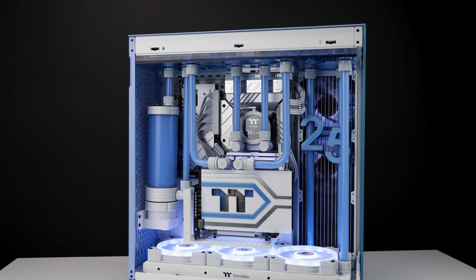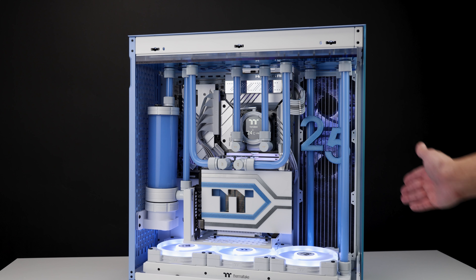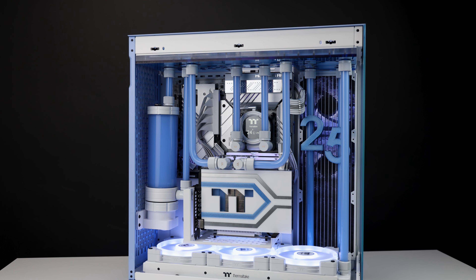If you're air cooling or using a 360 AIO on the side, it has excellent airflow. One thing I don't like about this case is the board support. It does support ATX but do not just buy any ATX board — the 24-pin may not be able to plug in. For certain boards like the ASUS Extreme which are a little larger than standard EATX, or something like an Aorus Master, you will not be able to use cables that aren't flat ribbon.